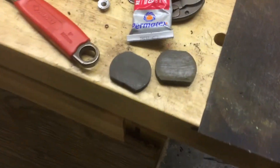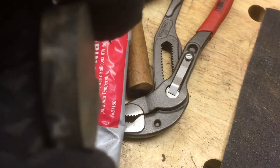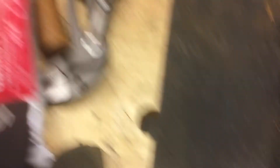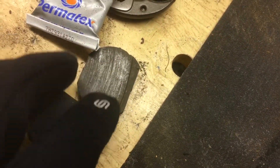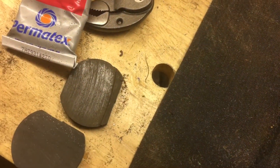So what I've been doing — you can see this brake puck here, it has this lip on it from all the wear from the manual brake caliper. What I've done with the other one is I've just sanded that smooth so it's a flat surface, so whenever these two pucks clamp together the two ends don't just hit each other and not actually bite down on the disc in between.